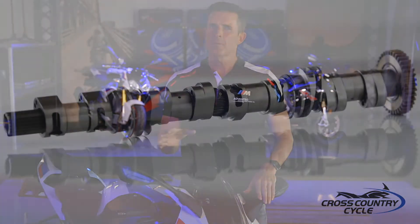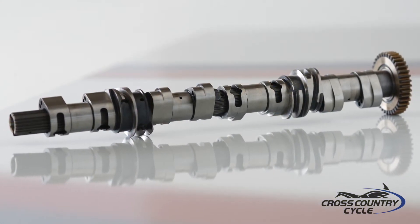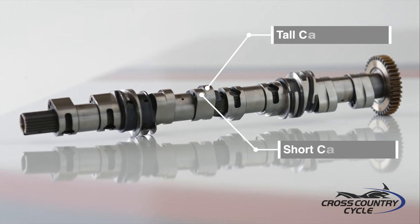But we can't push this chassis down the street, which brings us to the engine. The S1000RR's engine, utilizing shift cam technology, makes over 200 horsepower. BMW's shift cam technology is a split cam design with two cams per valve on the intake camshaft — one is short and the other is tall. The short cam is used at speeds below 9,000 RPM for maximum torque in the lower RPM, while the tall camshaft is used for full load and maximum performance up to 14,600 RPM.